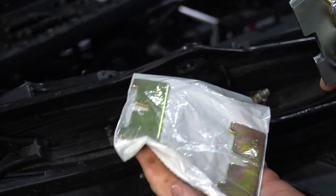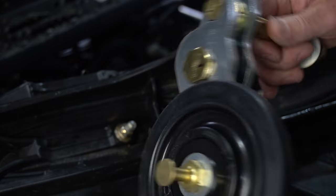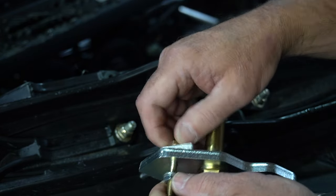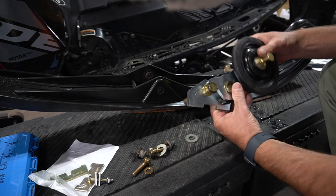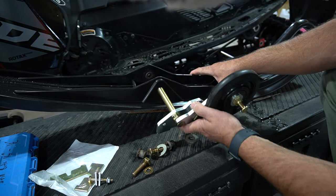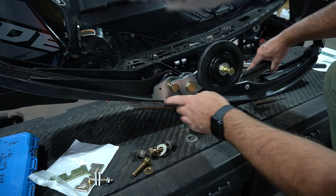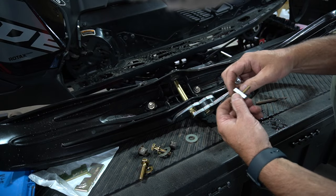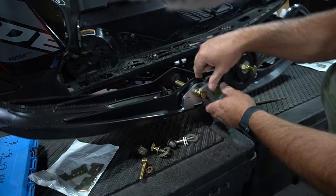There's a package of little metal plates that we have to keep handy and then the rest of the assembly comes together when you pull it out of the box. Dismantle the product and keep the pieces in order. You'll notice this one has two little wedges on it. There's a little pilot hole that we have to drill to keep this thing stable — we're going to do this before we put it onto the spindle of the sled. We're going to feed the roller ski through. If your skis are older they may be a little bit warped on the bottom, but notice these wedges are shaped to the same shape as the skis so they're going to go through. We're going to drill a quarter inch hole through there to the ski and then assemble that once we get it together.